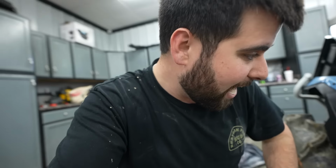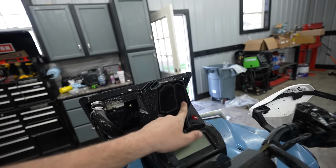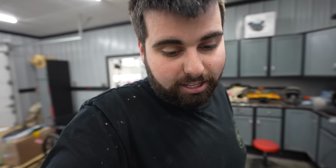Now, Jim just had a brand new motor installed on this thing, and we have a leaky belt box. What we're about to do, I won't recommend to everybody, but it's what we're gonna do because we do not have a smoke tester on site. What we're gonna do is fill the exhaust intake full of water. This being to the air box, you'll sink your machine. This one being to your belt box, it'll be fine. It's already full of muddy water. Running clean water through it's not gonna hurt it, and it'll help us find our leak.